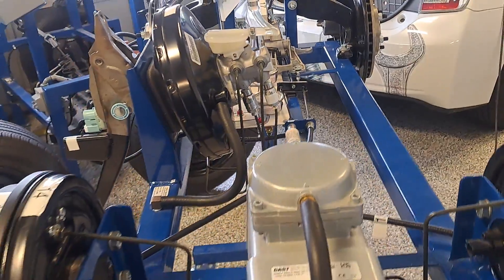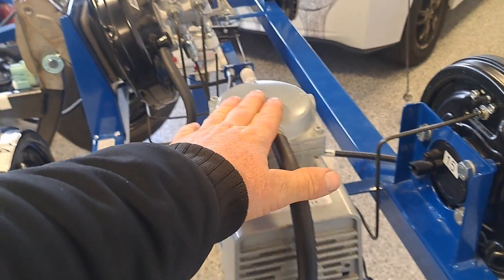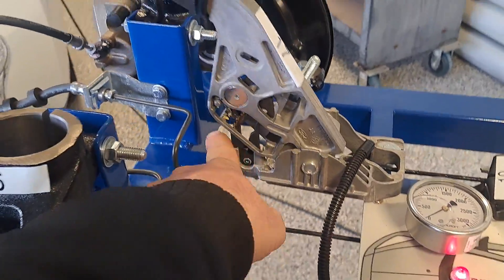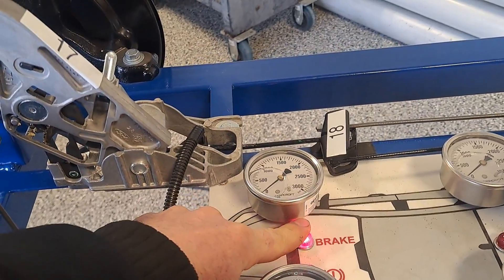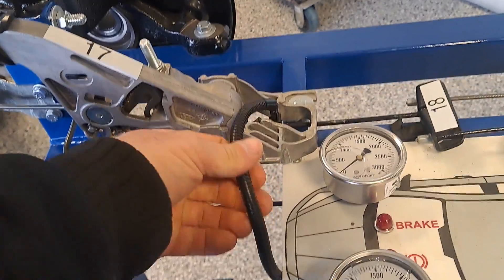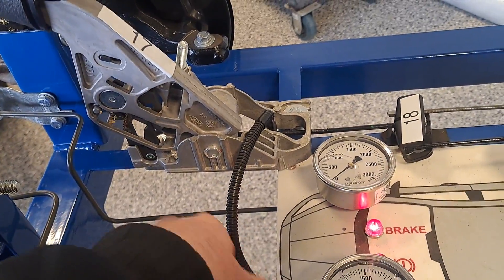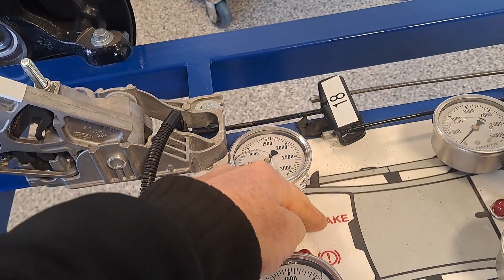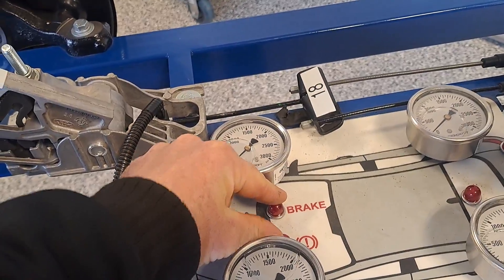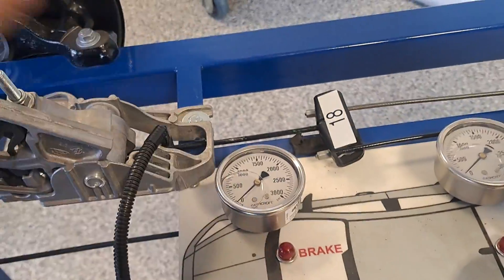When the car is running, notice it got louder — that's a vacuum pump that functions essentially like an engine, building vacuum. When I pull the parking brake, there's a small switch in here: when it's grounded, that gives us the red brake light. On most cars, the parking brake light and the brake warning light are one and the same, so if there's a defect in the hydraulic system like low fluid level or low fluid pressure, it's the same light — you're not sure if it's the parking brake or the regular brake system.